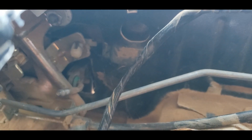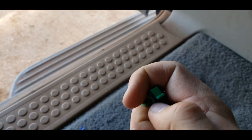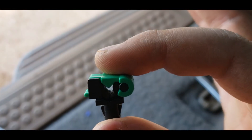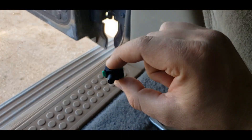Once you get it off, that's all the room you're going to have. This is the broken piece. This is what activates your latch right here. This rod is supposed to go up and on the backside attach to the new piece — and it's folded over now, but you can unfold it. You fold it over and you've got that center portion that's threaded, and then this other piece which snaps into place — snaps on the backside, your rod sticks up from the bottom, and that's how everything works. Without it, that's why the door won't open, that's why the latch is just all floppy.